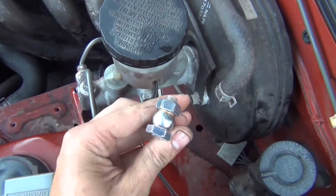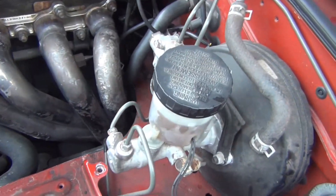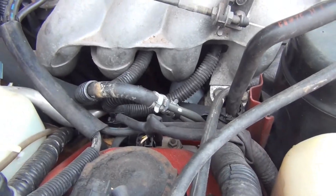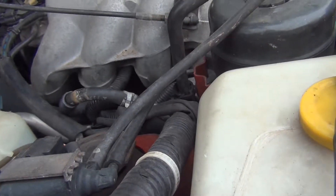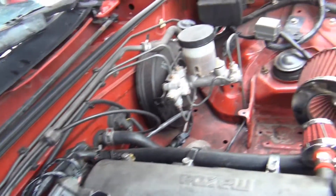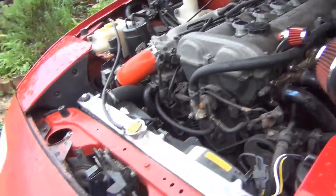This line has oil pressure now. For the 1.8 — everybody's doing videos on the 1.6 — if you're building a 1.8 turbo, the oil line has to come from up under the intake. Right next to the oil filter is the oil pressure sensor; you can kind of see the plug there. The oil line goes around the block and over to where the turbo is going to be mounted, and that's how it works.